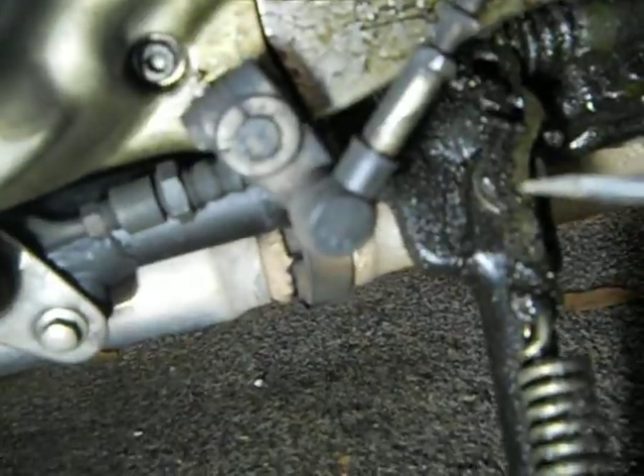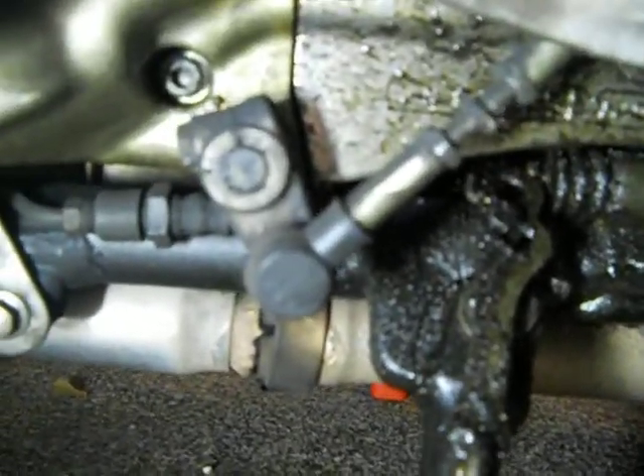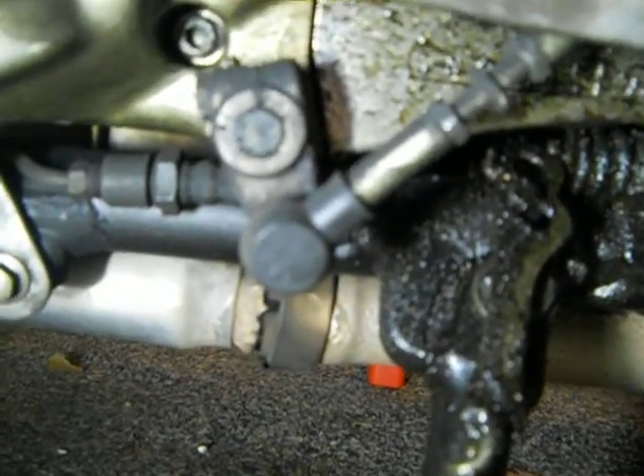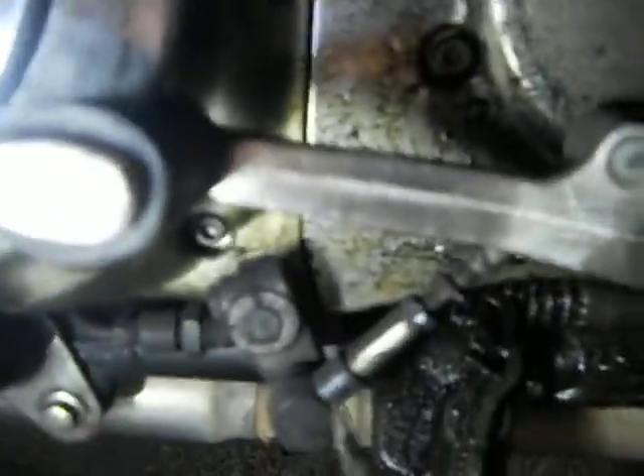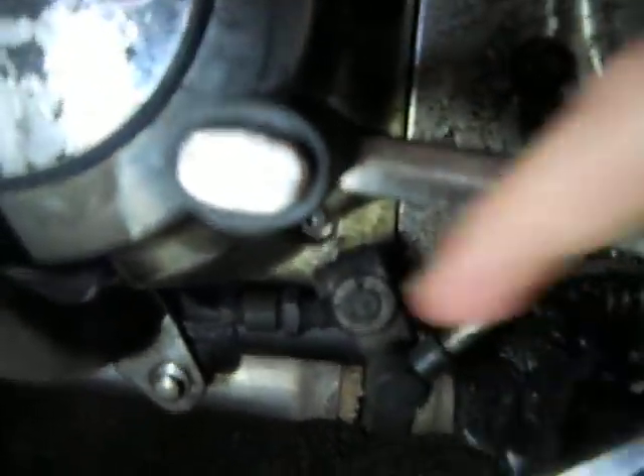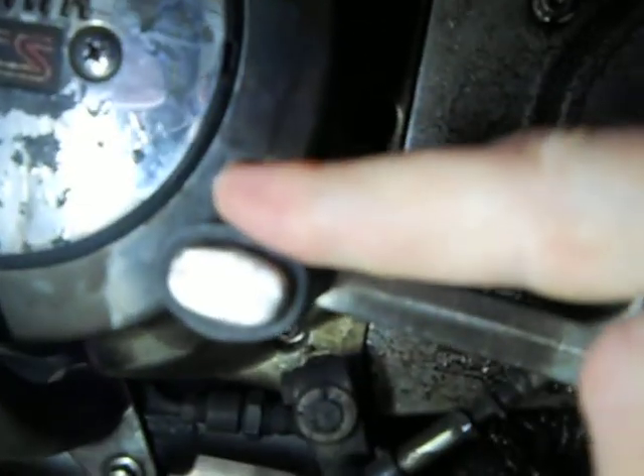Let me see if I can bend down here. Here's that shift shaft we're talking about — right there, see it? That's present position. Let me get a side shot. That's the correct position right now. When I push down on that shift lever — like going into first gear from neutral — watch. I push down on the shift lever, and here's what happens. See it move? It's rotating that shift shaft clockwise when I push down.